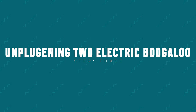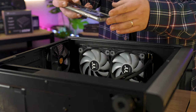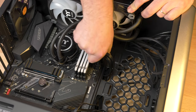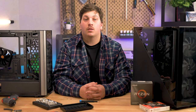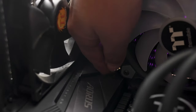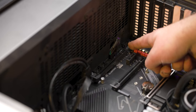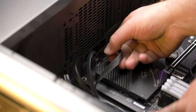Step three: with the graphics card out of the way, it's time to reach into the depths of the case and start unplugging things. Now would be a great time to take as many photos as you need to record where every cable plugs in. Start by removing the 24-pin cable, generally on the right side of your motherboard — don't be alarmed if it's a bit stubborn, that's totally normal. Next, tackle the CPU 4-plus-4-pin cable, located more often than not at the top left of your motherboard — again, with enough confidence it will come loose. Then remove the front panel audio cable, the USB 3 and 2 front panel connectors, any RGB cable headers, and the front panel power button, reset, and LED indicator cables. These will probably feel like the scariest ones, but you'll be able to put them all back easily — take a photo of the configuration now for safety.